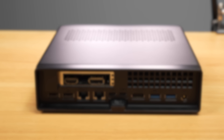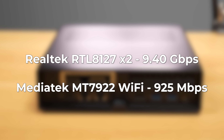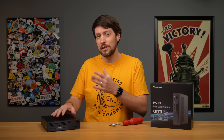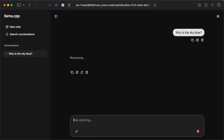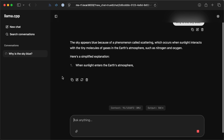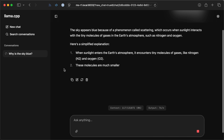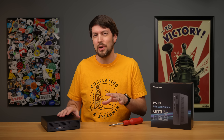Anyway, I kept testing. For networking, the onboard NICs provide a full 10 gigs, and the built-in Wi-Fi 6E was good for a gigabit on my network. With 64 gigs of RAM, one thing this box could excel at compared to an SBC is local AI, even if it's just on the CPU. I ran a bunch of different models that would fit in memory, and this is actually one place where it underperforms the older Orion 06 board that uses the same CPU. The performance inconsistencies are puzzling, but the power consumption is what really kills me.